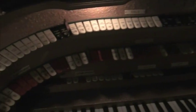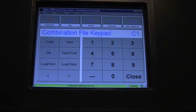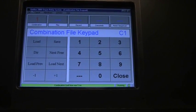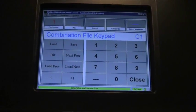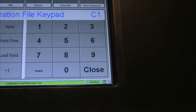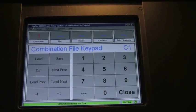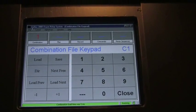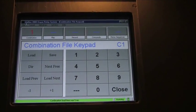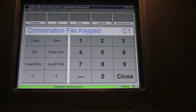I'm working on the organ. Primarily what I'm doing is upgrading their Uniflex relay system from Windows 98 to XP. The reason I'm doing that is because this screen here is a new screen and it's a touch screen, and the old touch screen went bad. Unfortunately, the drivers for the new touch screen will not work in Windows 98, which this platform is running on.